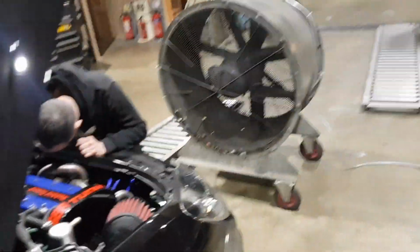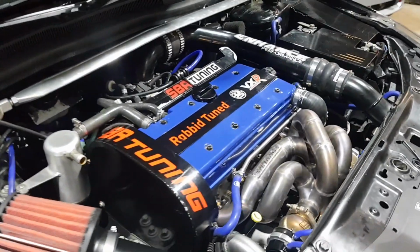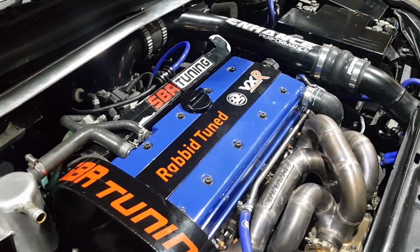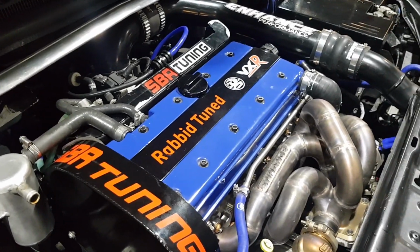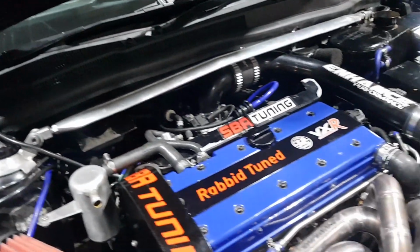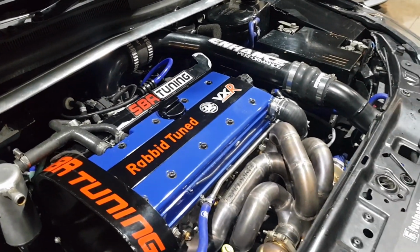We're thinking of looking at the inlet manifold, changing that from a Class over to an EDS. We may well see a decent amount of power gain top end, because it's just the breathing top end that's lacking, which is what gives you the horsepower figure. If you can increase your VE by 10% top end compared to the other car on the same turbo, that's 10% more airflow. 10% more airflow on 440, well, that's another 44 horsepower on top, which suddenly brings you up to just shy of 500, which would be much closer to the target you want.